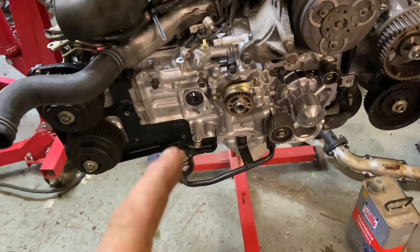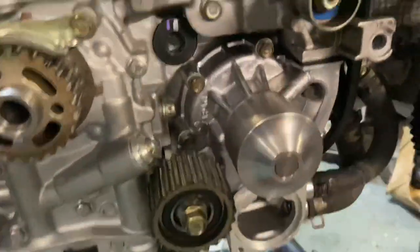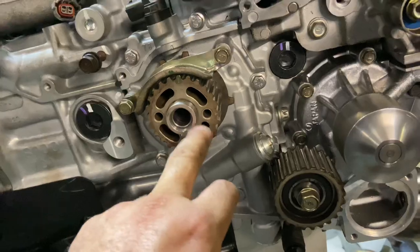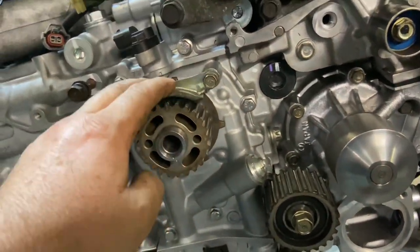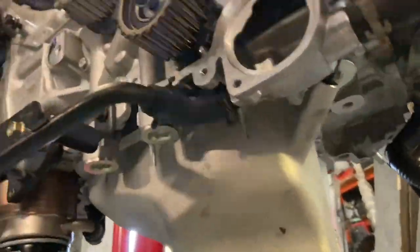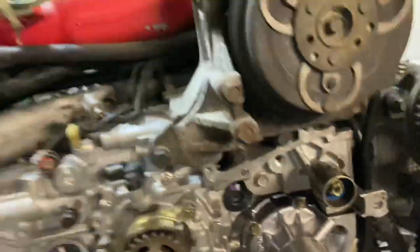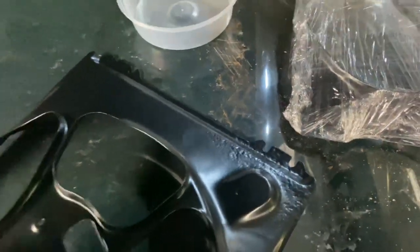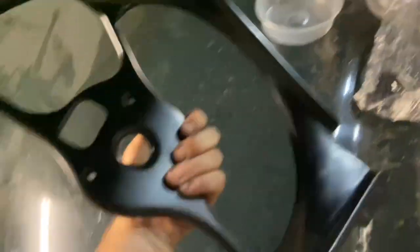This engine is from the blob eye. I bought a brand new genuine Subaru water pump for it, upgraded to the 11mm oil pump, and bought the IAG competition specs. While I've had it in bits, all the radiator parts and everything were grubby, so I had them blasted and coated.